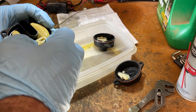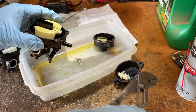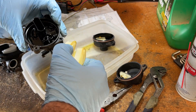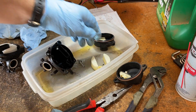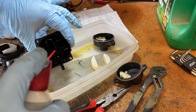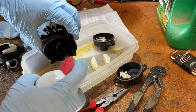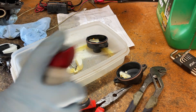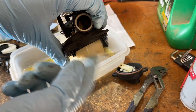We'll take off the float pan as well, just to make sure. Because this carburetor — pull the pan out — float and needle. Both of these are in good shape. Throw that in there, just because I'm going to spray them off too. The rest of the carburetor looks good. Perfect.